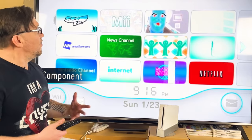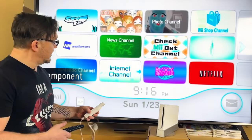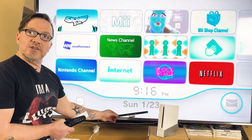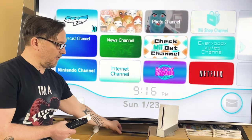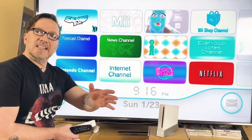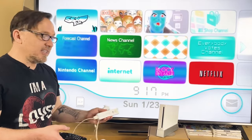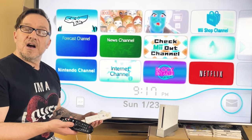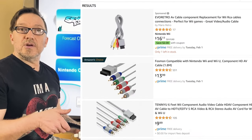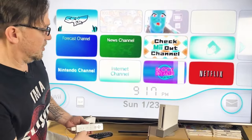Look at this beautiful Wii! Let's connect the Wii remote. Another tip: make sure to align your sensor bar to the bottom or top of your TV, whichever works best. Keep it close, and tape the bottom of the sensor bar so it doesn't get knocked — it's very sensitive. Sit reasonably close whether you're playing Guitar Hero, skiing, or anything else. Sensor position is really important, and remember that LED light tip from earlier. I'll put links below to buy the component cable on Amazon.